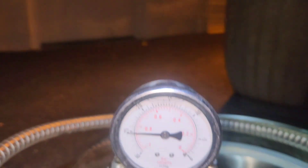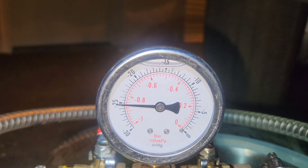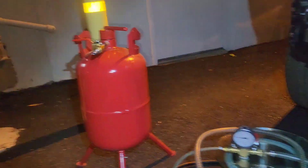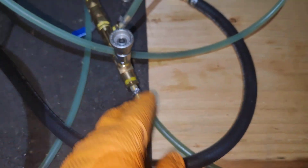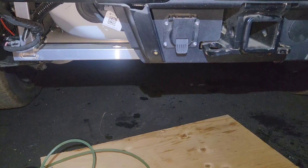Pull the vacuum down until it stops going lower — you don't need to keep running it to boil water out of the system, just get it to stabilize and then shut off the vacuum supply. Then apply 120 PSI air to pressurize everything and the system completely fills — you can see the lines are completely full. Once you plug everything back in, it'll start working again.